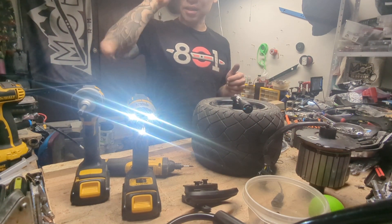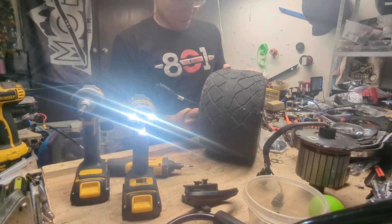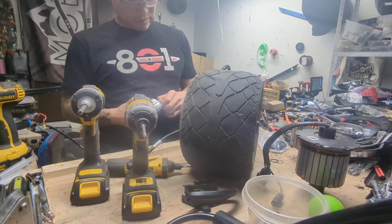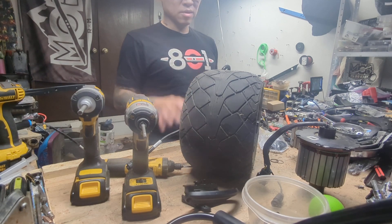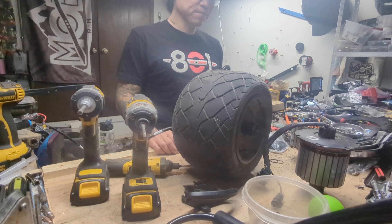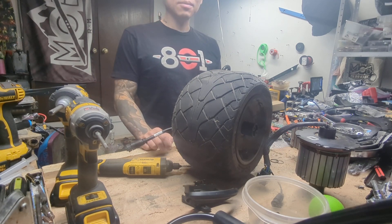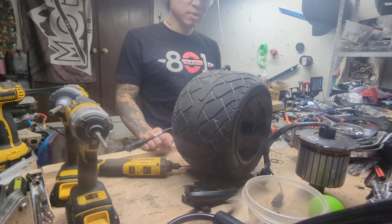The question is, am I going to install a clock carrier still? I am, because I believe in my own products. I'm going to do the installation in a different video because I want this one to focus on what we're finding out about the GTS. This is the first thing I check on everyone's board if they bring their GT to me and there's a problem with motor cogging — I know exactly where to go. The big things we wanted to see were the axle thickness and the o-ring groove depth, both of which have been improved. We all know the capacitors, MOSFETs, and some components inside the controller have been improved, but otherwise they're exactly the same.